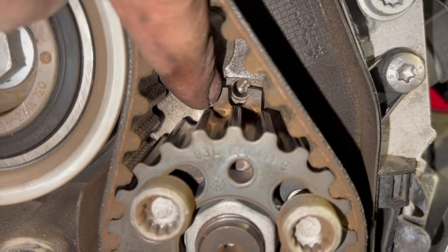It's got the idler wheels out there as well. Now, on the earlier engines, they used to be really prone to these studs, and used to like to change these, certainly on like the 19s. They're not too bad for failing on these later ones. Basically, one thing you can do just to check the stud is get a fresh nut and just run it up and down it, just make sure it runs up and down nice and freely along the threads, and that just proves that the threads aren't stretched. Generally, if that's okay, the stud's okay. So you can see that ran up there really nicely.